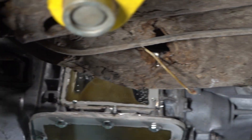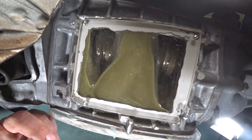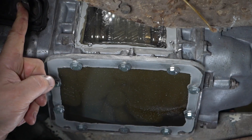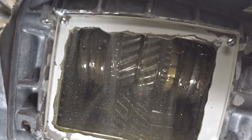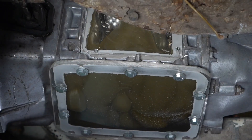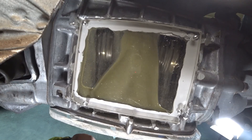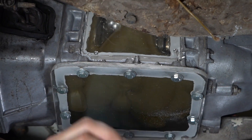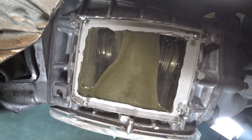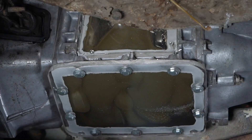Oh my, look at that — we ran the gearbox, and now I'm watching it flush out metal shavings. The gears are kicking the oil up and turning it into foam. You have got a very good view from over here. Oil getting kicked around. Clutch, and hold it. The shafts have stopped. Give me second. It's in gear, very nice. Let's go. It looks about the same as when we made that transparent differential cover — we also saw oil being kicked around and there was plenty of lubrication. This is also doing well. Look at how it's being sprayed. I wouldn't imagine there is a part in there that lacks lubrication with how it's being sprayed around.